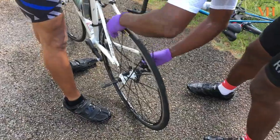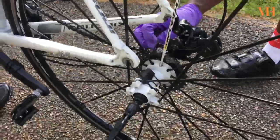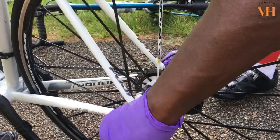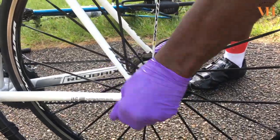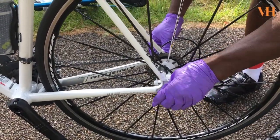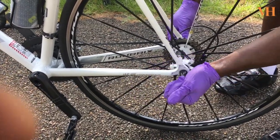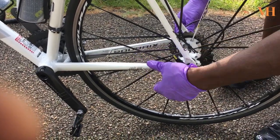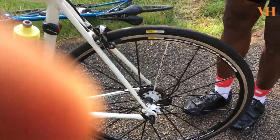So now the reason why we lined it up with the small chain ring — I don't have to remember where it was. I'm on the smallest cog. And even in racing, all the people changing wheels, they expect it to be here. So when the riders have a flat, that's the first thing they do — they shift to this cog, the biggest ratio. Now this is a little loose, I'm going to tighten it. You always want the skewer to be tight enough that you have an indentation in your hand. Because if it's too loose, it will start ticking when you stand, and sometimes it can affect your shifting. You need to have a little bit of effort on it.